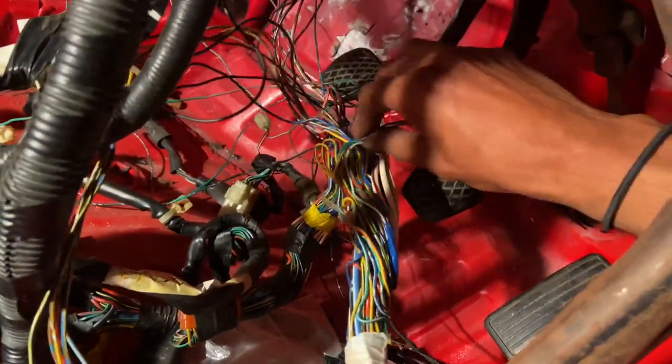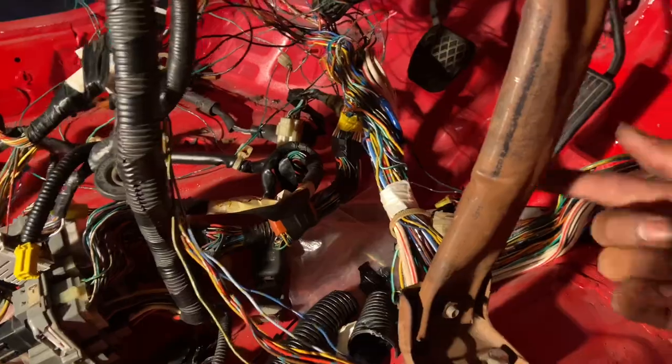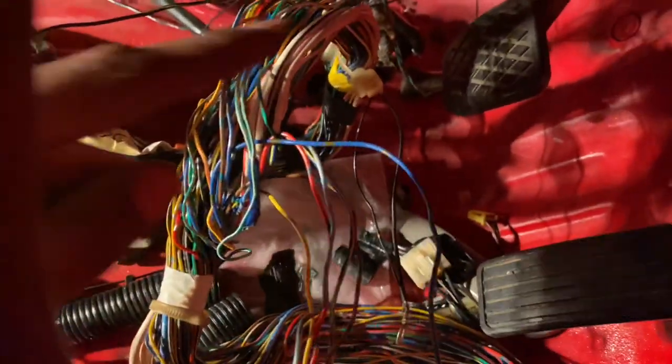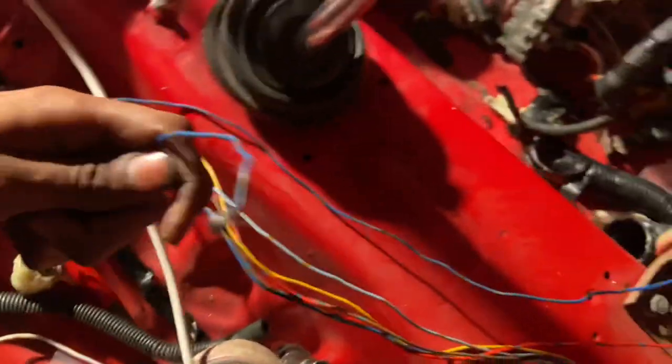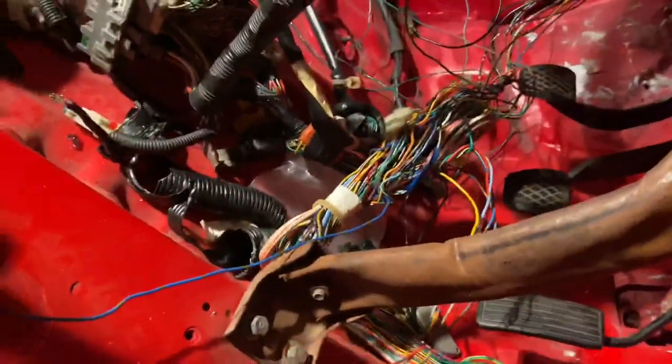We've got some progress - I've got everything un-loomed and the plastic case off. Pretty much what I'm doing is pulling this clump of wires through the loom - you have to push them through all kinds of wires and they're all twisted up, but I've done this on another chassis harness before so I know I can pull all of these as far as I need. I cut these two wires - a black ground going to the ground plug over there - and then I cut this yellow wire. This blue wire was kind of off doing its own thing so I ended up de-pinning it from the plug.